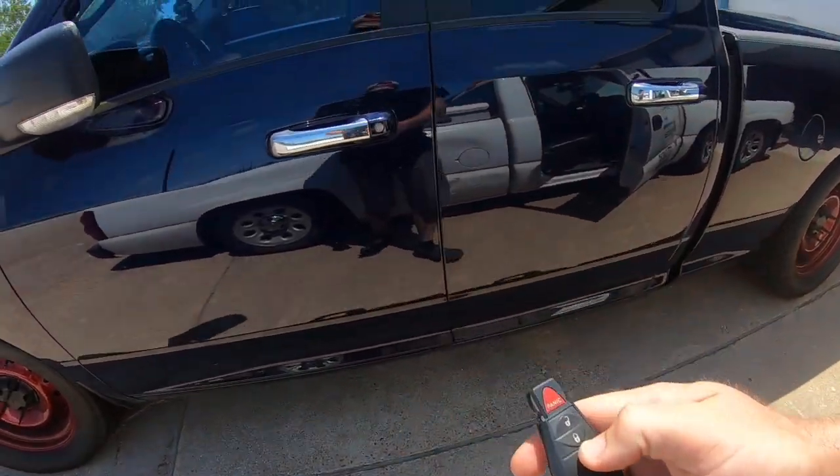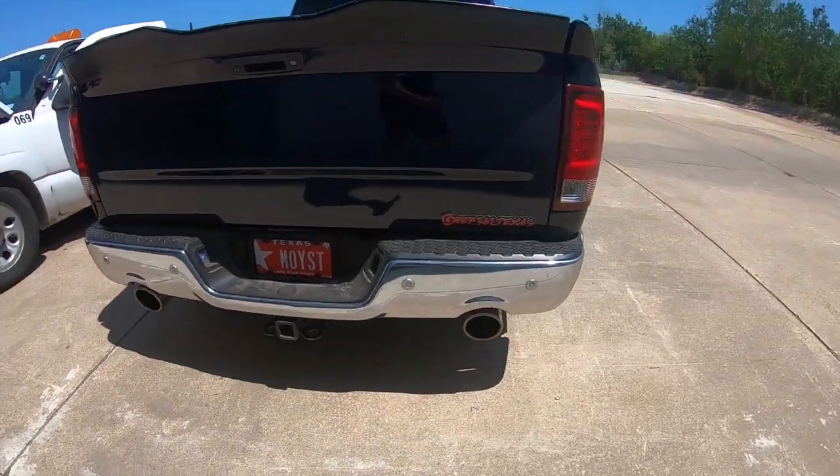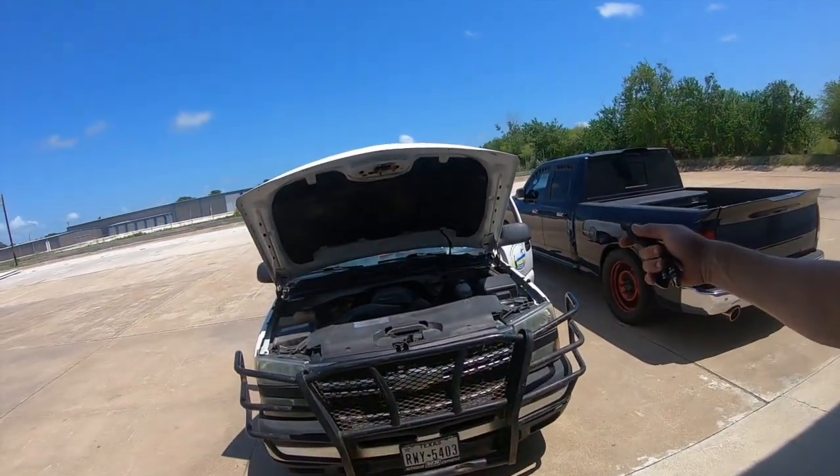Let's go ahead and do a cold start on this guy. That truck has 85,000 miles on it, 80 bottles of nitrous, been tuned since about 15,000 miles, taken to the track, raced hard. If you maintain your AFRs — and your maintenance in general, of course — AFRs play a big role in the longevity of your engine. Whether it's a truck, a car, or even a boat, you just need to know what AFR that thing is happy at running at wide open throttle.